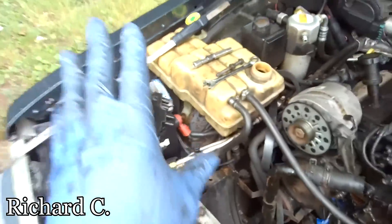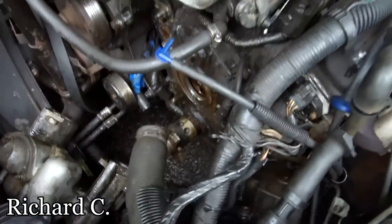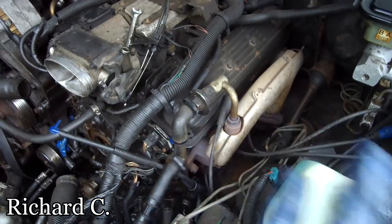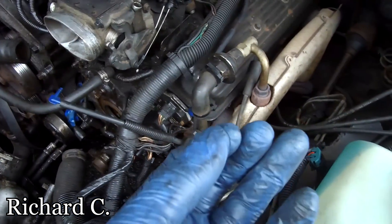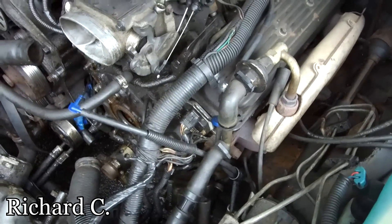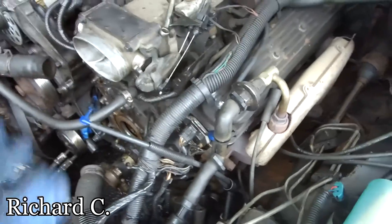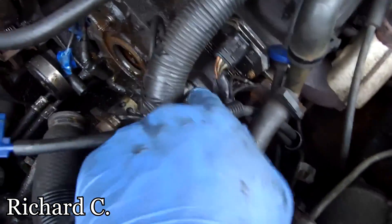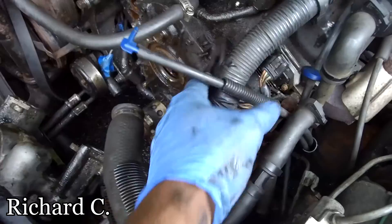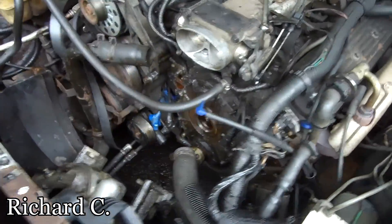Now why did I determine that was the problem? Well, it didn't have any spark. I changed the spark plugs and then took one spark plug out — I had the old one — and when it shut off I took one of the plug wires out and it did not spark. Later I turned it back on, then it sparked and the engine started with the spark plug arcing on this metal part. So I thought it could be the coil, but then I turned the coil on when it was not running and the coil had power.